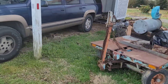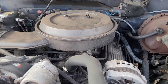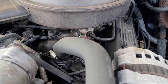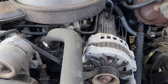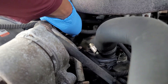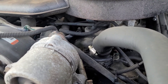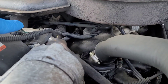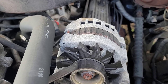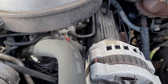I'm about to put a throttle body gasket in big blue. The gasket went out before. It's gonna need some valve cover gaskets, maybe even an intake manifold gasket. Just by looking you could find stuff — it's blowing the PCV valve out. It's probably time for a new PCV valve. I'm seeing a lot of oil, so that could be pressure in the crankcase.